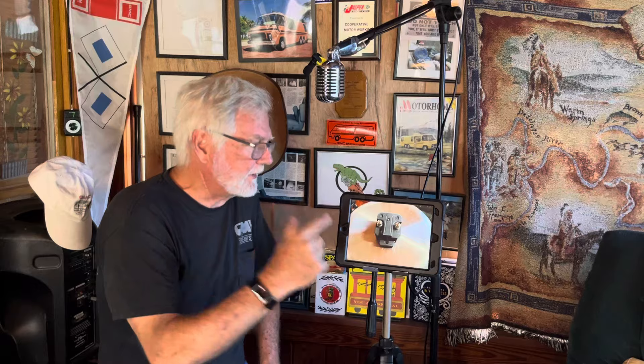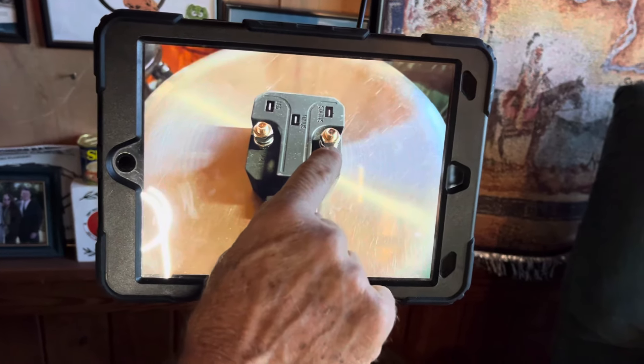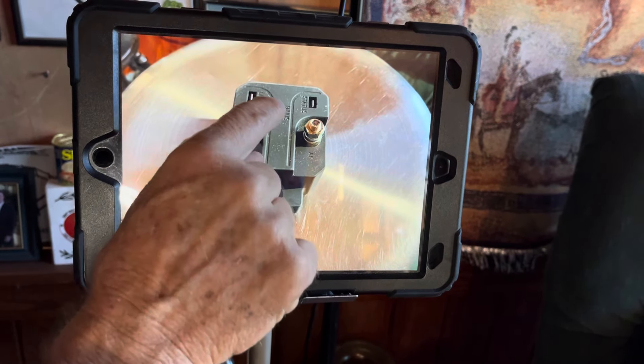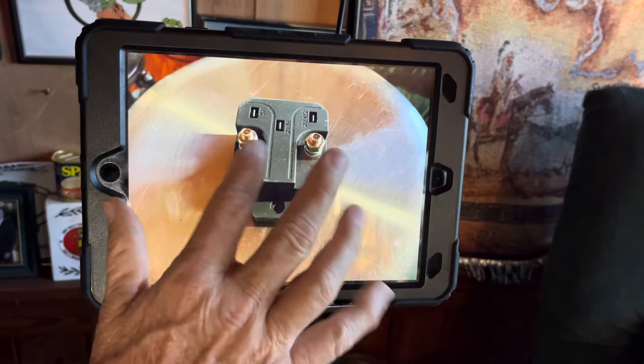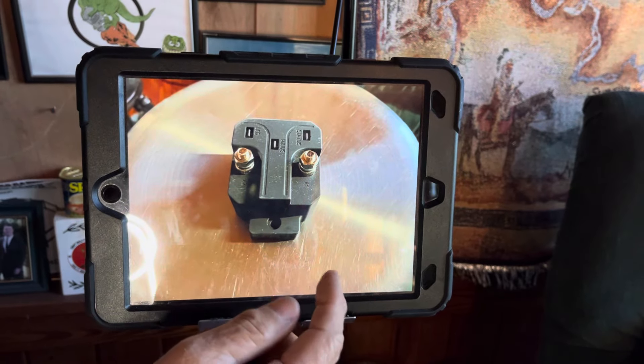On the last episode I was talking about having a one-wire alternator made, and I'm going to put in an ACR-160 SEMLAX — S-E-M-L-A-X — ACR-160. Take a look here — we're going to be doing this tomorrow. Just like your boost solenoid: the A1 side gets your engine electrical system, the other side gets your living area electrical system, the center one is a ground, and the one on the right is your trigger for your boost switch. When you push the boost switch it'll tie it in. So not only does that replace the boost solenoid, it will also replace the battery isolator.